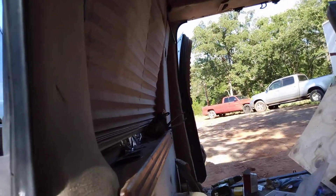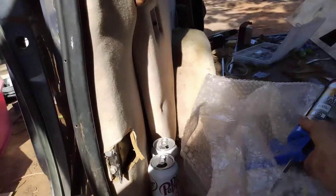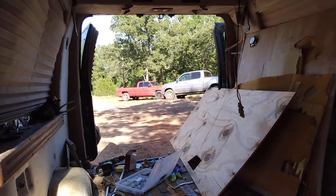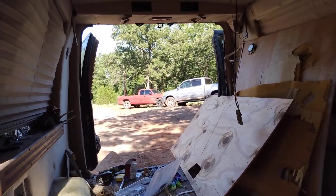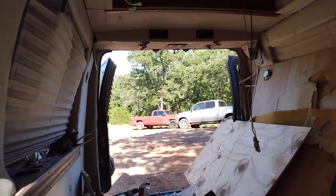Then I dicored it really well with self-leveling lap sealant — you know, this stuff right here. I've used at least two-thirds of that tube on that roof right there. I didn't want it to leak. It has to sit for about 24 hours to really harden up, and I waited to do this until we had no rain in the forecast for the next couple of days. It's going to be nice and hot so it'll cure and we'll be good to go.